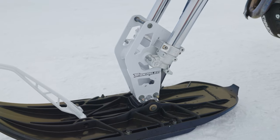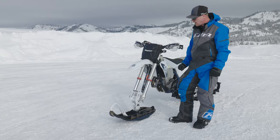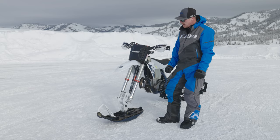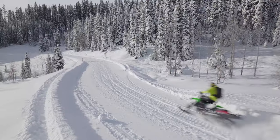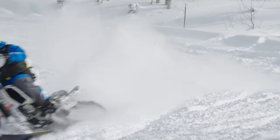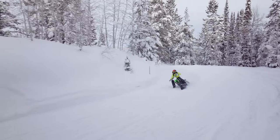You can see we continue the use of our Traverse Ski and Spindle Kit. This being an S model, obviously we have the low spindle on it. What's really unique about this is we've completely redesigned the ski rubber. Although that sounds like a really small change, the way it makes the machine handle is absolutely incredible. When you come into a corner, you can really come in hot and drive deep into the corner. As you're coming around, the ski doesn't want to trail chatter at all and allows you to really accelerate hard out of the corners.